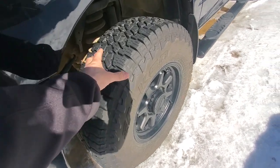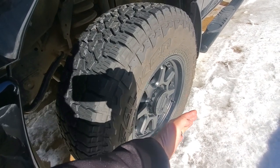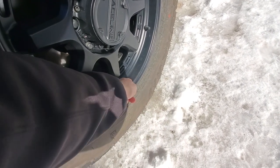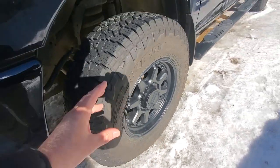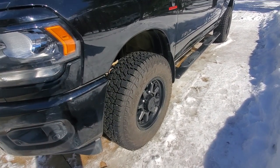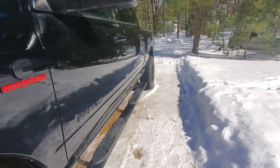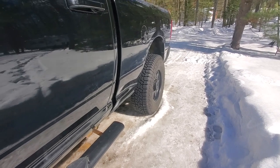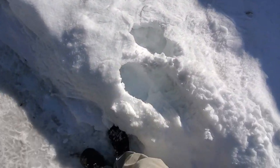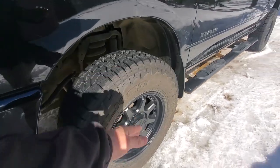Then the width of the rim - how wide it is across - is going to matter. These are 9-inch rims. If I went with 10-inch rims, that rim would be wider, pulling the tire more and giving a stretched look. If I went with an 8-inch rim, it would give more of a big bubble because the rim would be narrower and that tire would curl more, giving more protection. You can run 10s, 8s, or 9s - you can do whatever you want. After my research, I chose this 9-inch rim because it gives good sidewall protection. You can see I'm not going to hit a curb and get curb rash. The rim diameter and the rim width are the key considerations.